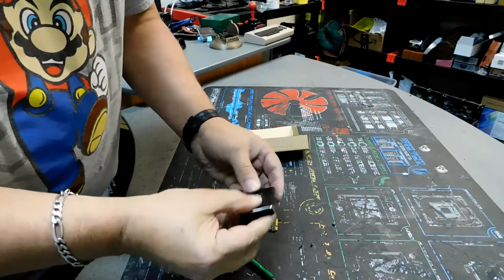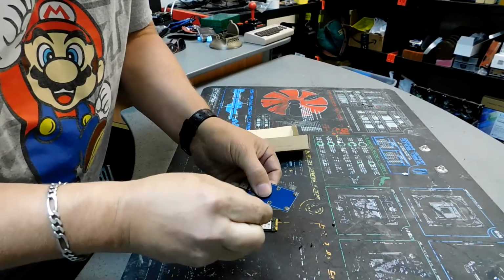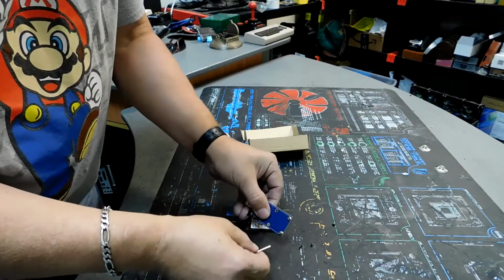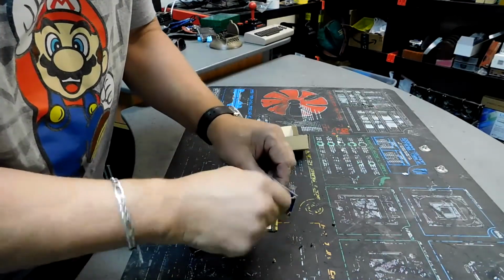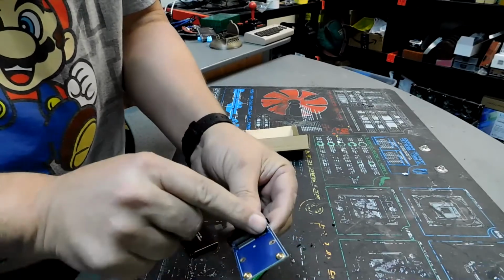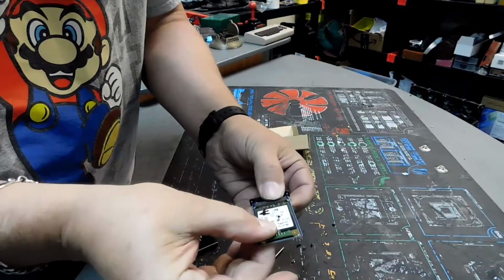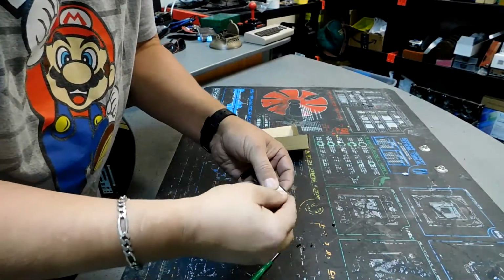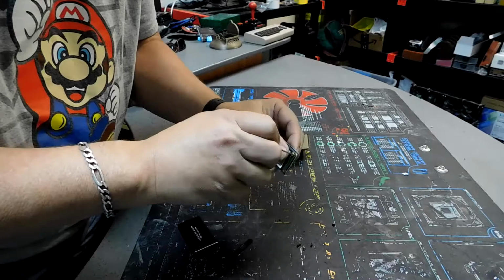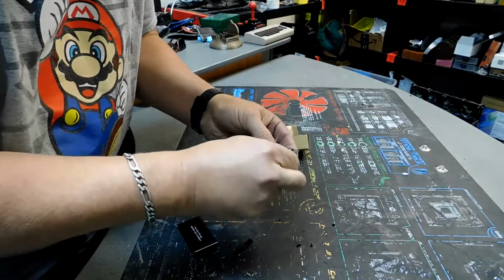So, all right, we pulled out these back two screws, and it looks like this thing slides forward. Yep, there you go. And it looks like we got a couple of these little micro screws to hold down the card. So we're going to go ahead and pull those out and set those aside. Now, I don't know how well this is going to work. I do know that this is designed for the mSATA, and you guys can see that funky connection in there. All right, so let's go ahead and put that in place. There we go. And we're going to put these screws on and lock it down. Now, of course, that's not really necessary because we're just going to use it for this one drive and then take it back out again. But as you can see, it locks down in there nicely.